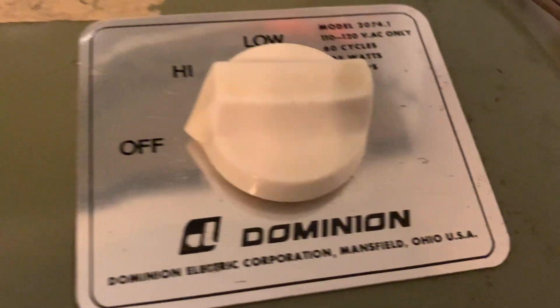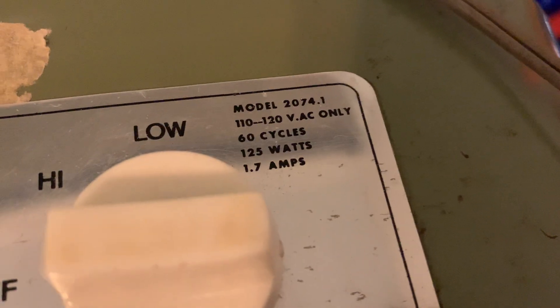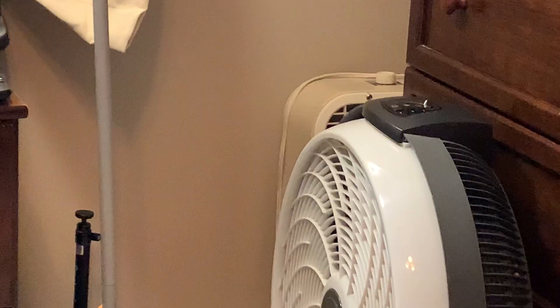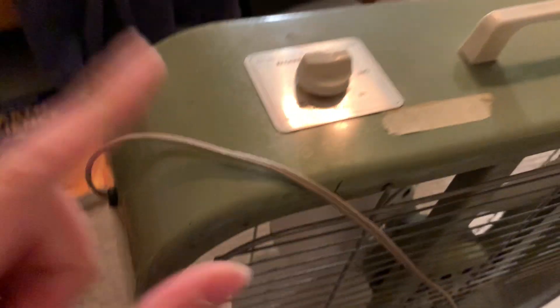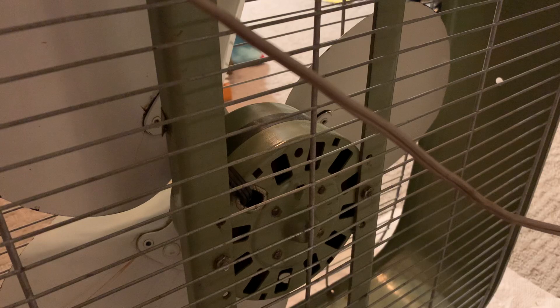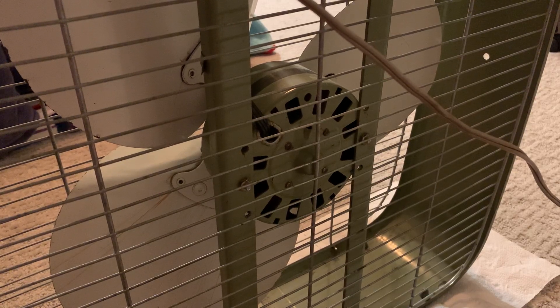Here's a little tag sticker. It says Dominion, model 2074.1 — but no one cares about the .1. Here are all the stats: 1.7 amps. It is not 1.7 amps — I will guarantee you that. This motor is way more than that, probably 2.2 or 2.4. You want to know what 1.7 amps is like? That fan there, my P2D3, that thing is weak — that's 1.7 amps and on low it barely runs. So that's not 1.7 amps. Any fan that has that little sticker and says whatever amps — never believe it. If the motor has a sticker on it, the motor is probably going to be correct. If you ever see a sticker on the motor versus a sticker on the cabinet, always go by the motor because that's going to be the most correct. The cabinet sticker is just a guess — it's pretty much never correct.